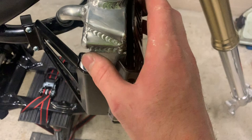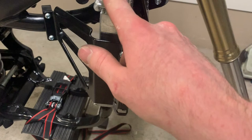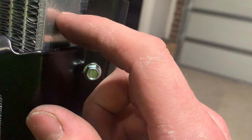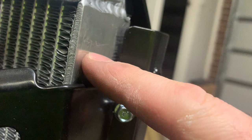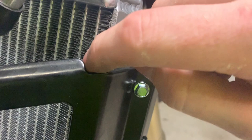I need to figure out a way to fix the radiator to the guard. Those tabs I cut off were supposed to be bolted between these two points but they were never going to line up because it's a cheaper aftermarket radiator. What I might do is drill two holes — or maybe just one — in the radiator brace, and also drill a hole in the outer bar of the radiator. This outer plate doesn't have coolant flowing through it, it's just structural. So I can drill a hole here, put a rivnut in this plate, then put a bolt through the radiator brace into the rivnut to hold the radiator still.